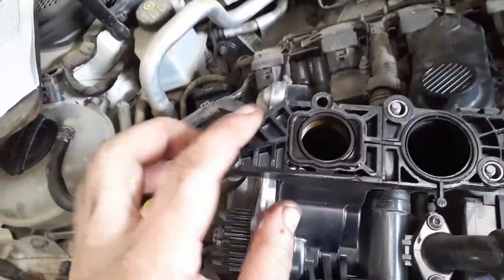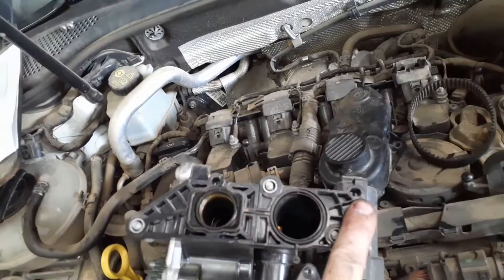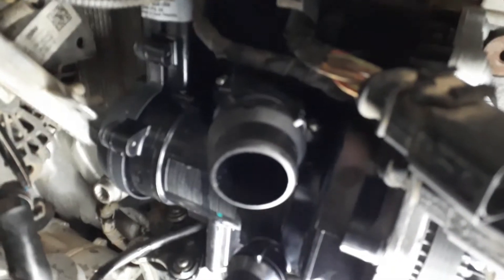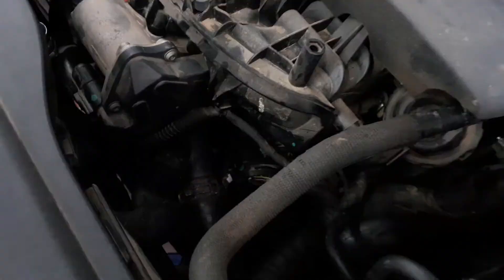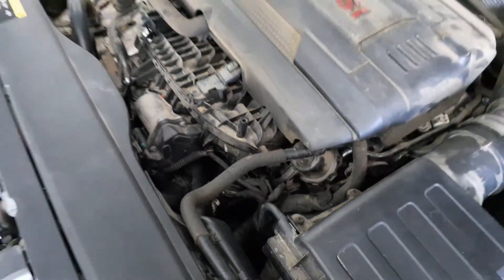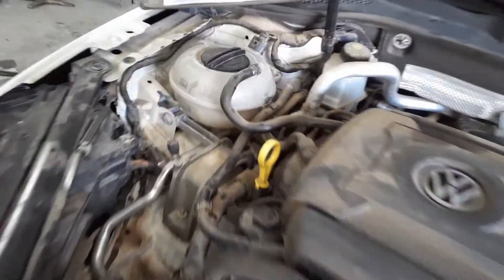You must remember - you can see on the old pump there are locating pins. If you try to force it you're going to end up cracking the water pump, so when you're lining it up make sure you're watching those pins. We've put in the top bolts and you can see the dial in the corner there. Once you've finished reassembling everything you can just add some antifreeze.